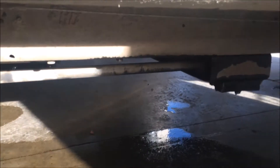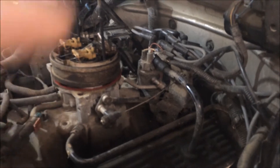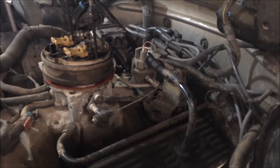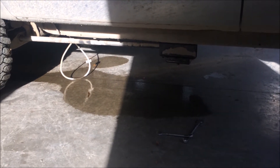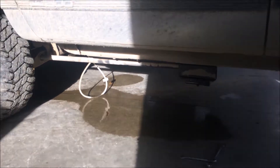I got the old fuel line disconnected — poured gas everywhere — and got the new one, which is actually a braided fuel line instead of a hard line with a soft line in the middle. It's hooked up to the filter. What I'm noticing is it was disconnected up here, and that whole fuel line was unsecured, so every time you hit a bump it's just bouncing around hitting stuff. I'm thinking that's the cause of the leak — unsecured fuel line bouncing around for who knows how long eventually rubs through somewhere.